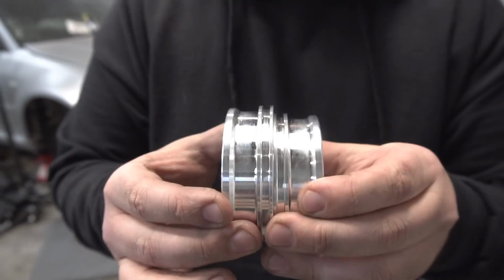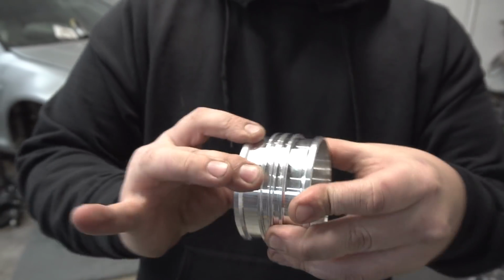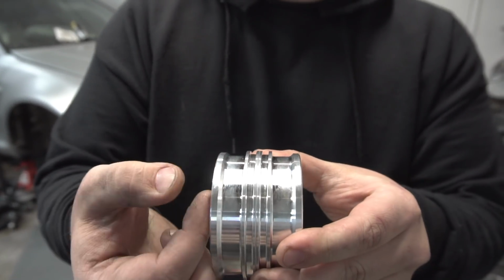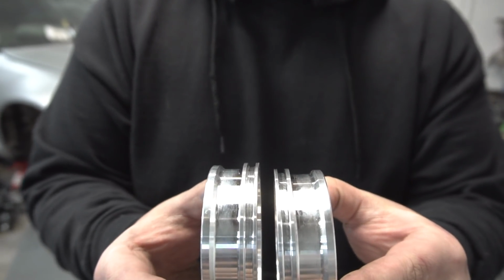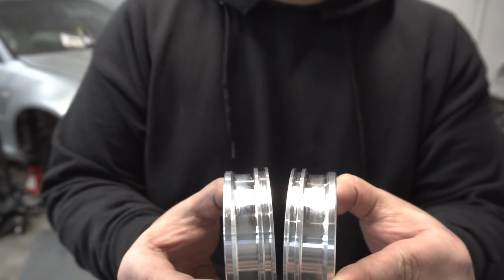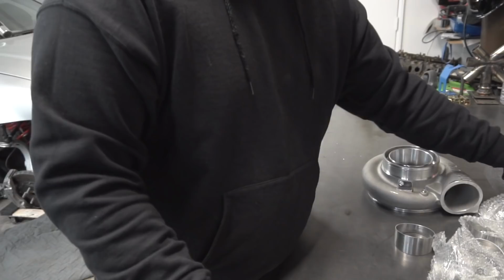So a lot of people just mount these up together, tape them, weld piping, but there's no movement here. They're laying against each other, and all that abuse goes on that joint. So that little spacer kit for alignment gives that gap. So now in the clamp, this is allowed to shift. And here, let me show you guys what I'm talking about. It's allowed to move up to 12 degrees.